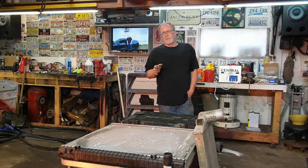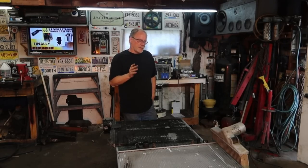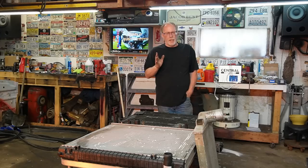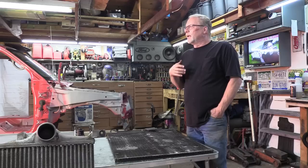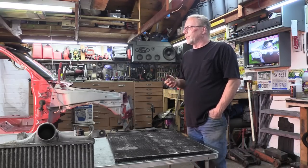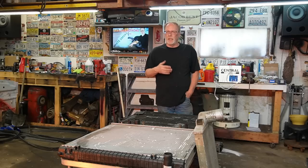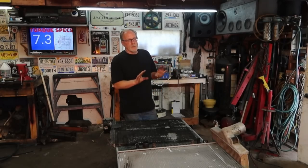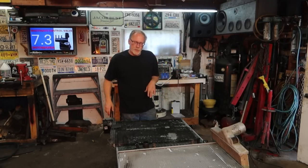Well, start out with the front of the truck first, the grill. Now, if you're running anything besides a standard grill, even the aftermarket upgraded grills, and you've got stuff over the top of the grill, or you've got that fine mesh like window screening, you're just causing yourself future problems. Because all the crap that comes on the road is going to end up jammed up in there, and your system is not going to be cooling properly. Got to keep that front grill open. Keep any extra accessories out of the way, but let that air flow through there.